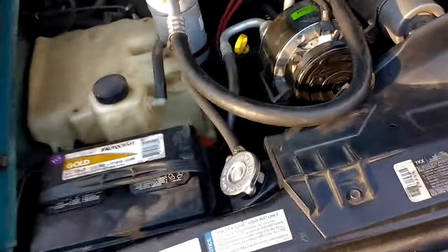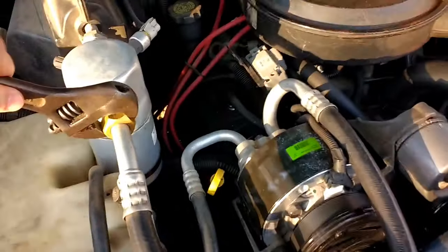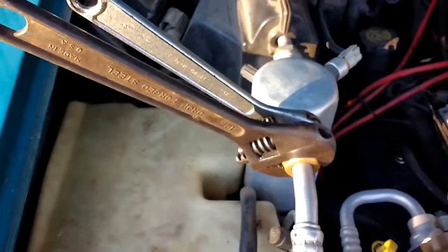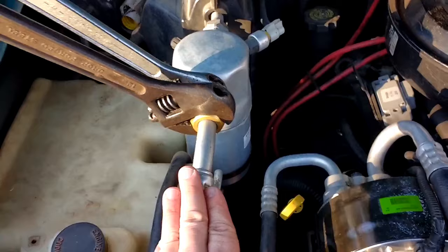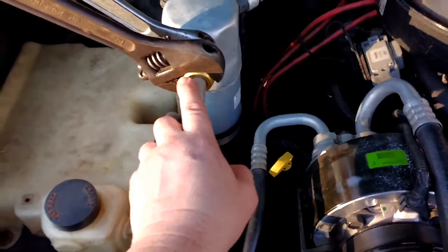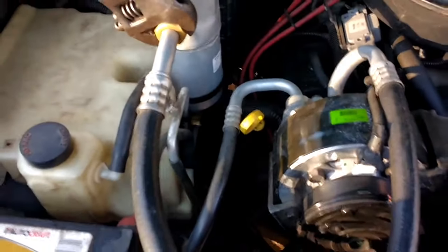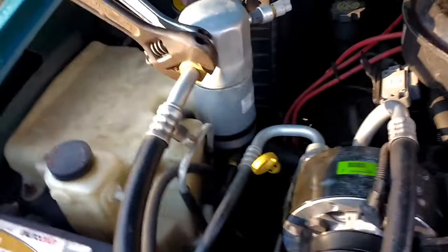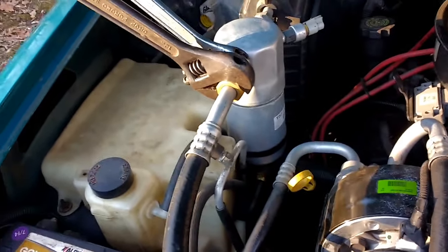Some tools you'll need: a 10-inch adjustable and a 12-inch adjustable wrench. You definitely want to have both of them and use both hands, because you don't want to stress the aluminum or the brass and possibly tear off or create a crack when dealing with any of these connections. You've got to be careful with it unless you want to spend extra money replacing parts.